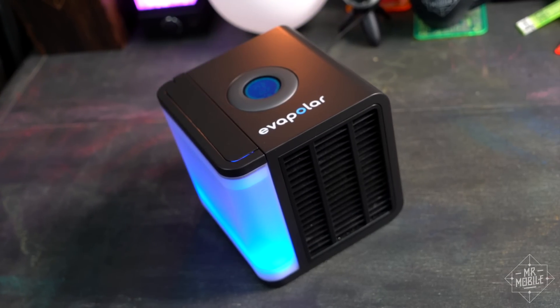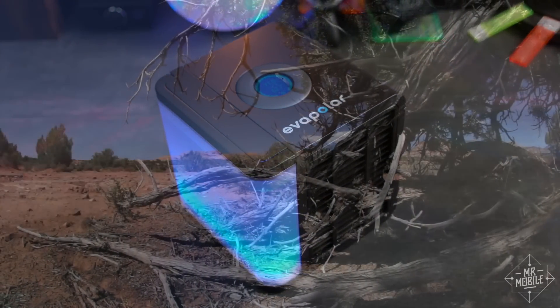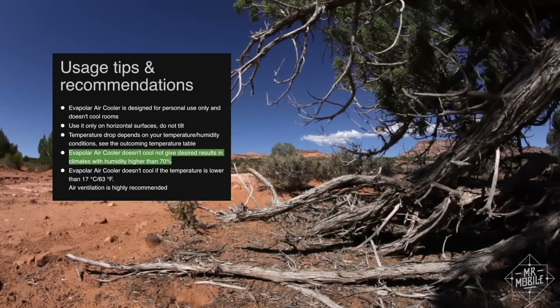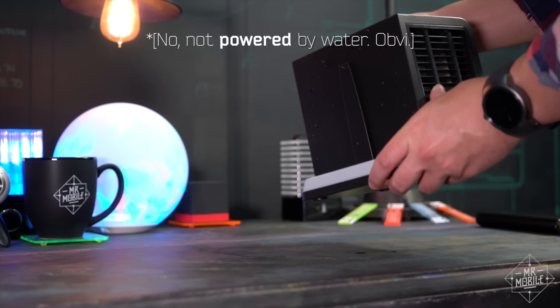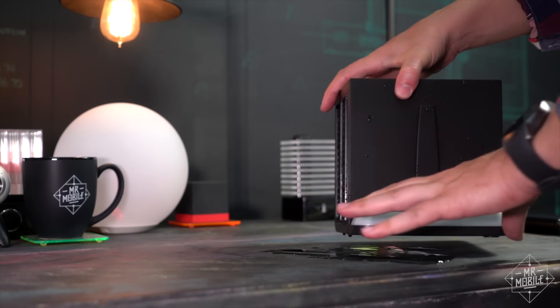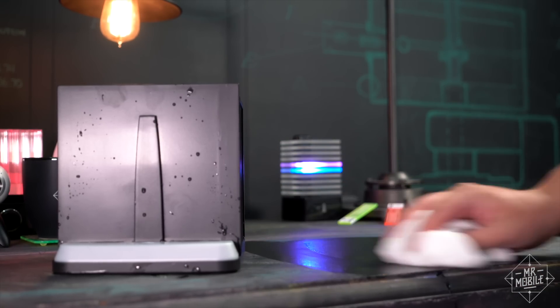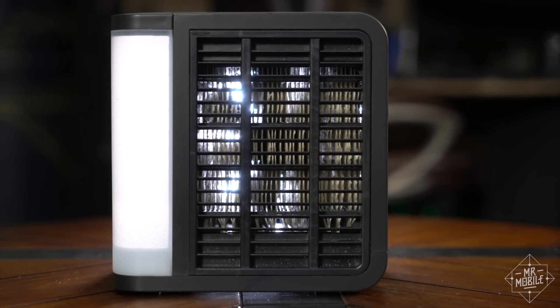What's not great about it? Well, because it's an evaporative cooler, it only works well in dry heat. Very humid environments nullify the process that makes the whole thing work. And because it's powered by water, it leaves water everywhere unless you keep it absolutely level. So keep a rag around until you figure that out. Also, the filter needs to be changed about twice a year — each of those is 40 bucks a pop.